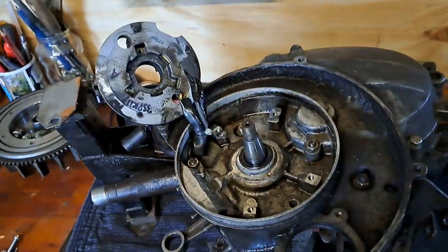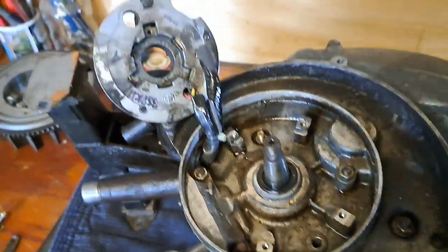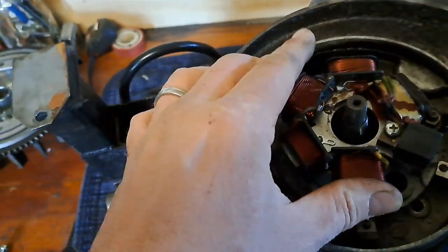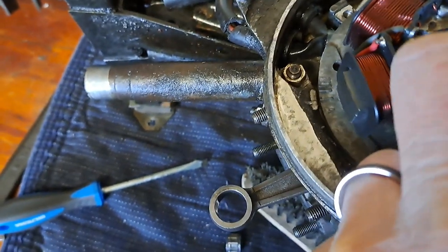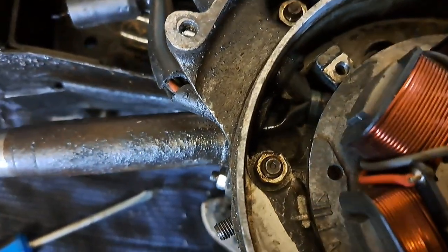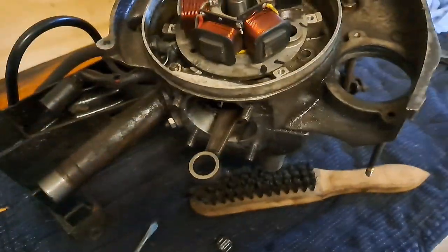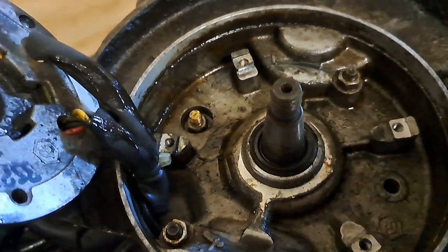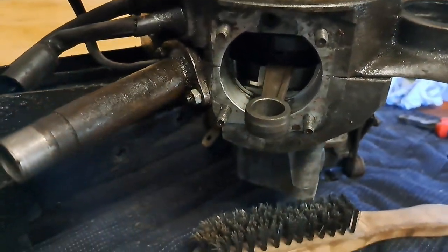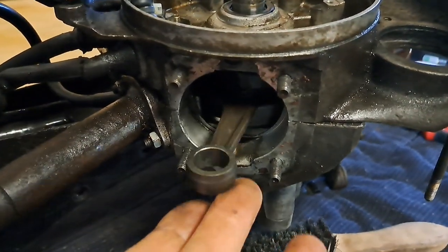The engine is off and you can see it's filled up with oil and grime, so the seal is probably broken. This here is the rotor, and it's got markings — you can see that right there. When I took it off, it was like this, so I'm thinking when I assemble it again, it should go back like that. You see all this grease and oil — something has definitely sprung a leak. I do suspect that thing in the middle. There's oil everywhere and it can only come out one place: the seal. And there's quite a bit of play here — more than there should be.